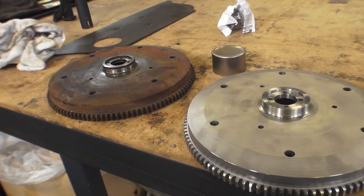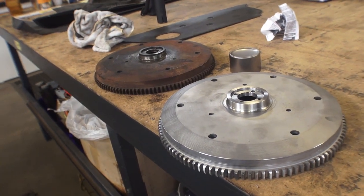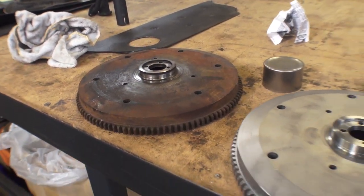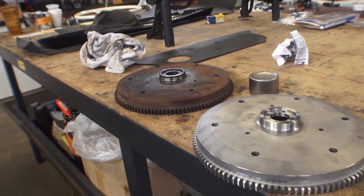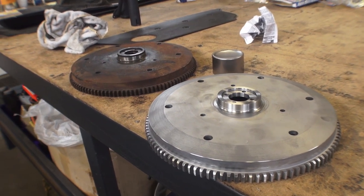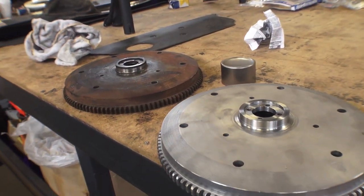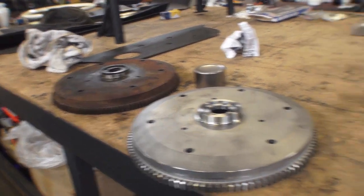So here we have two flywheels. This is a 36 horsepower motor — they do not make these flywheels anymore brand new, so you can't really get these brand new. Yes, you can send them out to get machined at a machine shop. For the most part you cannot get these new — later style motors, 1600s, 1500s, things like that, 12 volt motors, you can get brand new flywheels for these cars. But the early ones, you are forced to either send the flywheel out to get machined, or another alternative that I have come across recently from a Porsche friend of mine — he sent me his Porsche book, the Stoddard Porsche book.